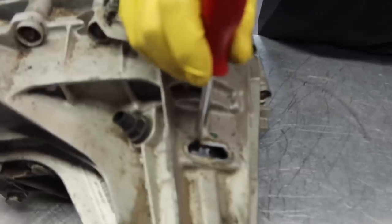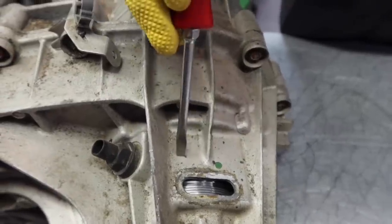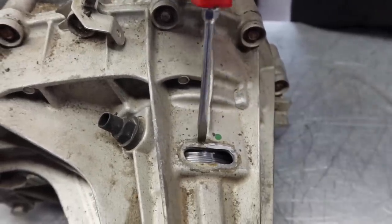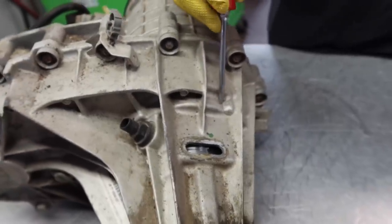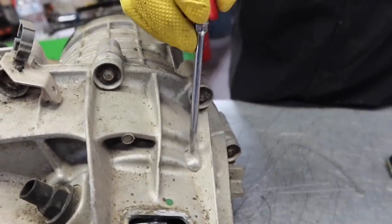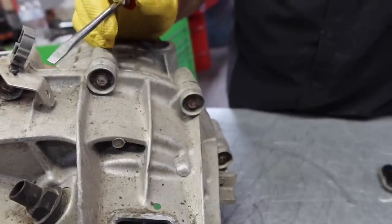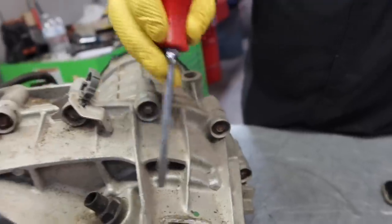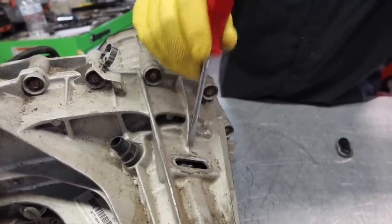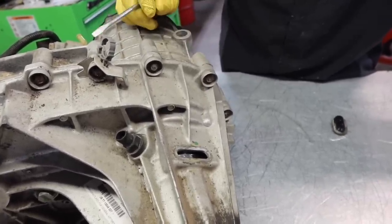Almost every one of these remans that comes through here as a core ends up like this. We pop the rubber plug out and you can see there's a threaded sleeve down in here. Instead of throwing the housing away and putting a new one on, they've machined it, run threads down in there, and put a sleeve in. The problem is the sleeve backs off, opens up the end play in the back of the case, and you'll have problems. Also, if you look closely at the tip of the screwdriver, there's JB Weld or metal epoxy on there where they patched the case pump rub — again just to reuse the housing.